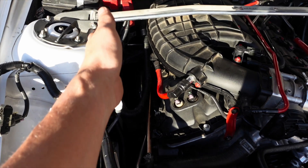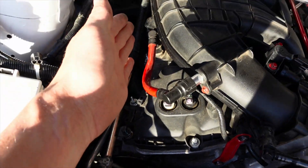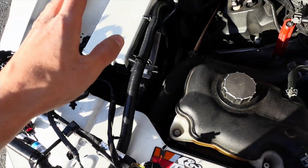We just got done removing one side of the wiring harness — unplugged from the PCM, unplugged from the clip below the radiator hose, and removed everything off the side of the block. Then we started plugging in the new wiring harness right behind as we were removing the old one, so I wouldn't forget exactly how everything was plugged in.